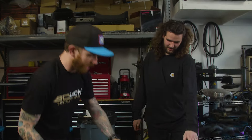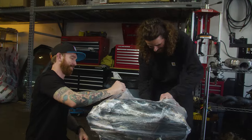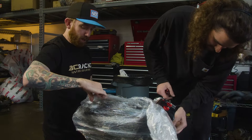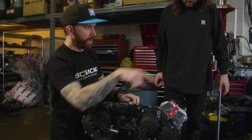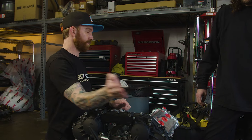Got a fresh motor coming in — just getting it unwrapped. That's the one we just took out of the car and stripped down. We did the compression test on the two motors. This one was reading lower, and I'm going to go back through the build notes because we were trying different style pistons between the three motors. It's probably mostly to do with this one being the lowest compression just out of the box — not just because it's hurt, it was across the board.